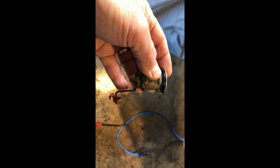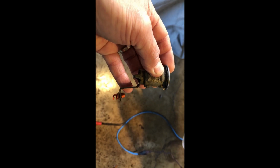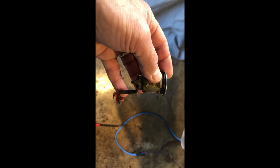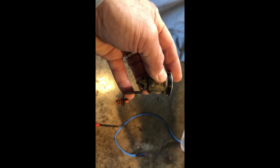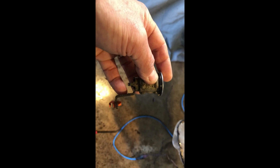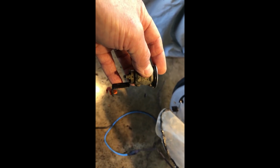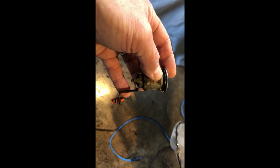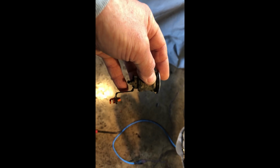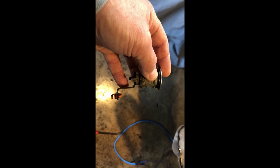And what I wanted to show you is where my pinky is. That's that Z-shaped piece. The plastic orange clip is what connects to the rod that I showed earlier. That's what actually, when you turn the key, where my pointer finger is, in there, and turn the lock with the key, it moves this piece, which is connected to the button on the door, which is where it was jamming. At least that's what it felt like. But it was actually binding right here because this Z-shaped piece was just not quite aligned, and it was binding.